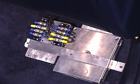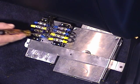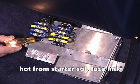Okay, let's say that we still don't have current back there. Now we need to go to the fuel pump relay and check that. Now, of course, my pump relay system is out here where it's easy to troubleshoot it. The first thing we want to do is to see if the wire that's supposed to be hot all the time is hot. And in this setup, it's this wire right here, and you can see that it is hot.